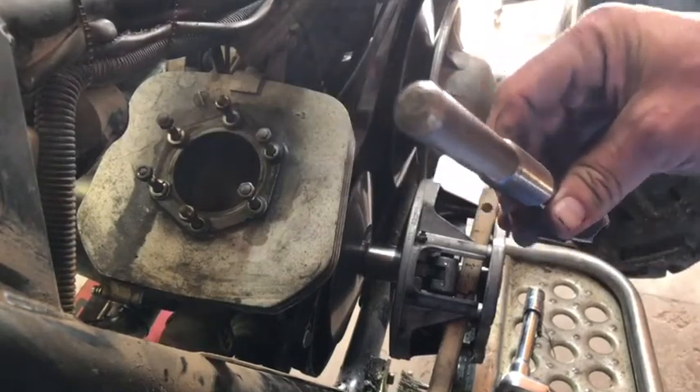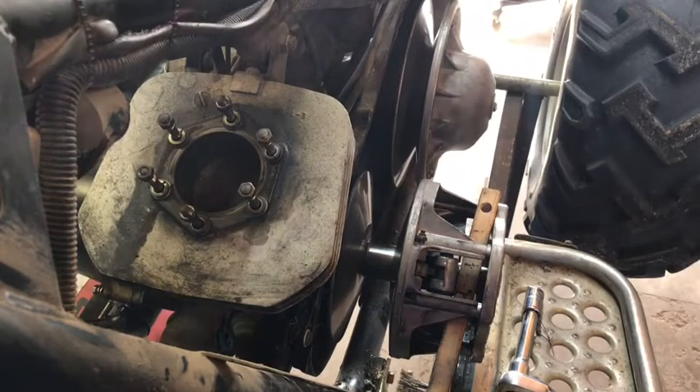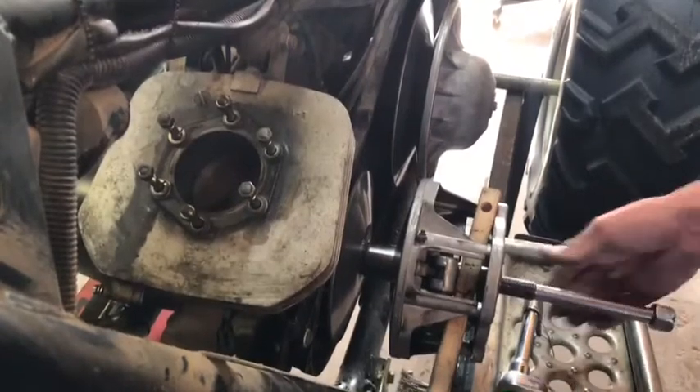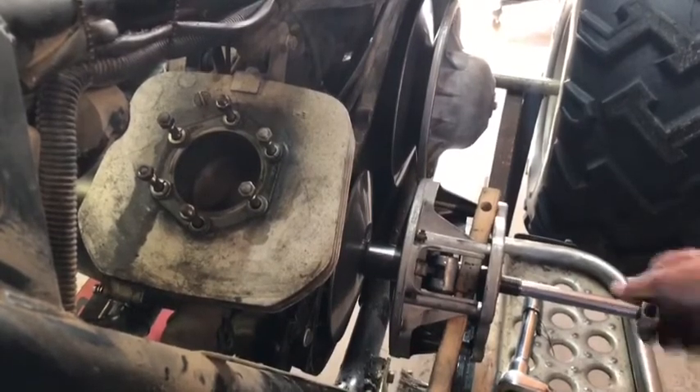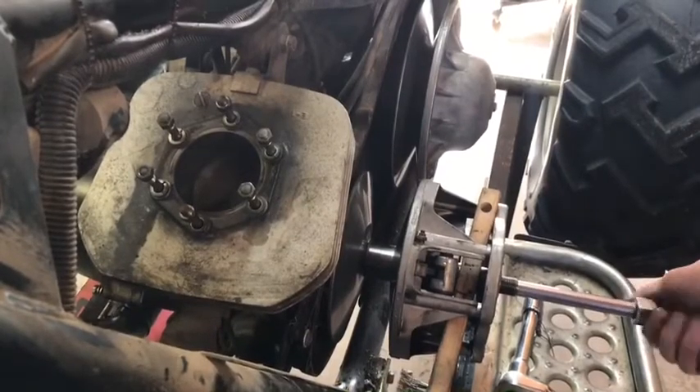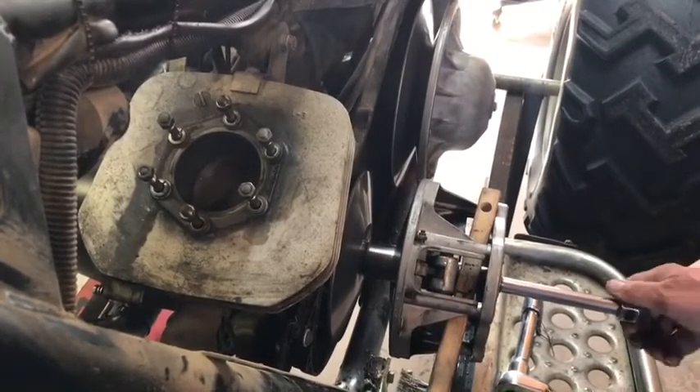On the end here, put a little bit of grease. I would say I'm a whole lot against using an impact. If you don't have to use an impact, then don't use it. I would much prefer that you use heat on the shaft — if you have a heat gun, just heat up the center between the two sheaves. You want to clean that grease off when you're done with it; that just helps lubricate the puller. Let me just grab a socket, then I'll have to switch this around because I'm then turning it in instead of turning it out. Let me shut you off while I grab a socket.